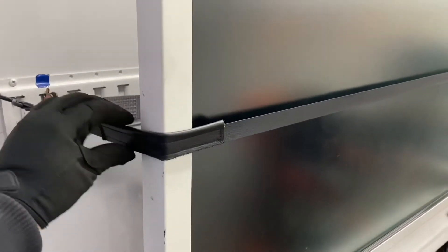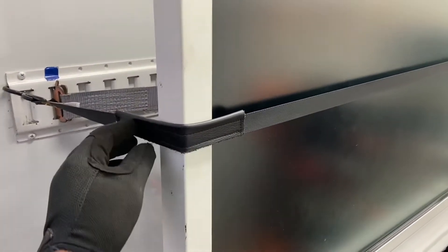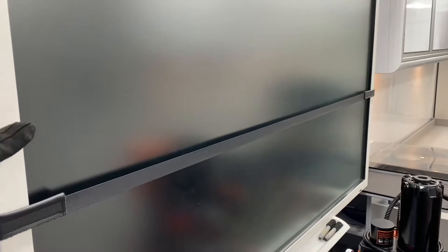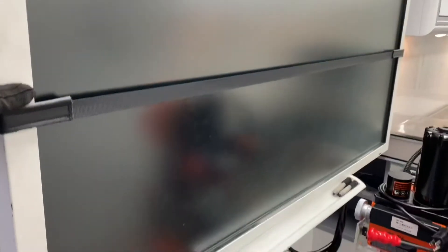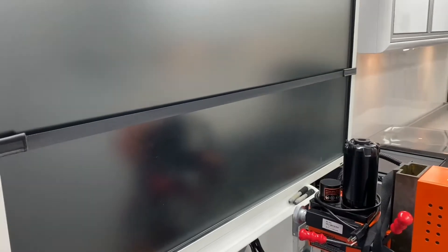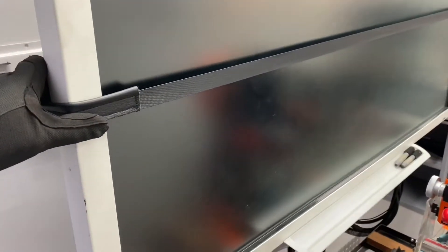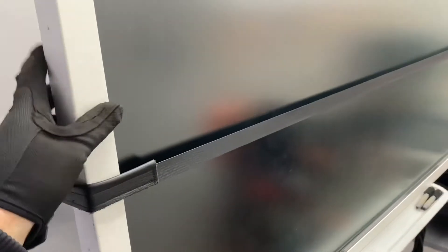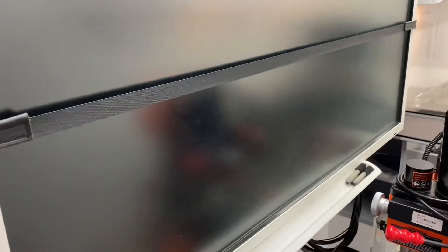Another little thing — this strap up here. I sewed leather into this side and into the corner side, because this smart board monitor would start to shake back and forth — wobbling, pivoting on the stand — like a harmonic flex going back and forth all the way down the highway. It did a lot of damage to the stand, but fortunately we caught that. With this strap cinched into the e-track on both sides, it stops that wobbling completely.